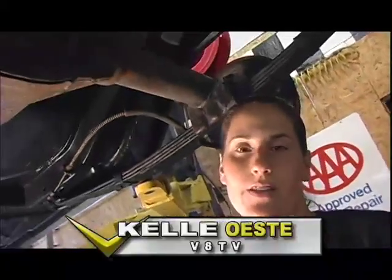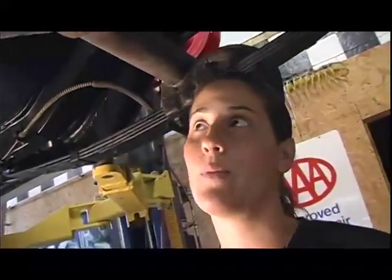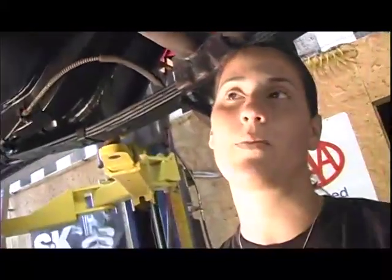The next step was to move to the rear of the car. So we're at the process of assembling some of the 69 Firebird, and the reason we're doing some of it is in order to put the front clip on, the car has to be on its wheels. So we have put the subframe on and the rear end, and we're just using the original rear end. We're waiting to find out if we may be getting a different new rear end or not. We're not sure yet. We're very soon going to install a Currie 9 Plus custom crate rear end so that this car has a better gear choice and a better differential than the stock unit.